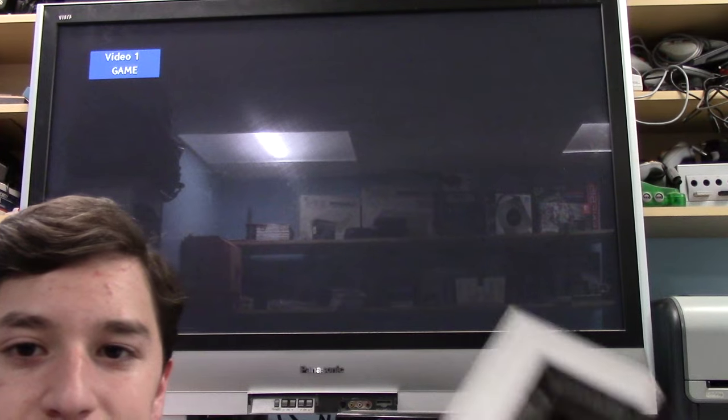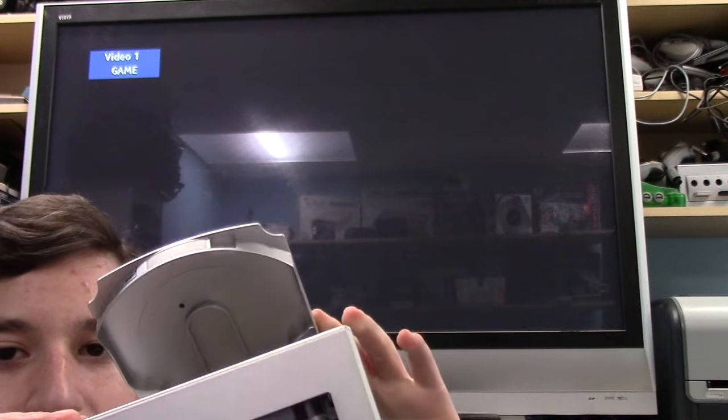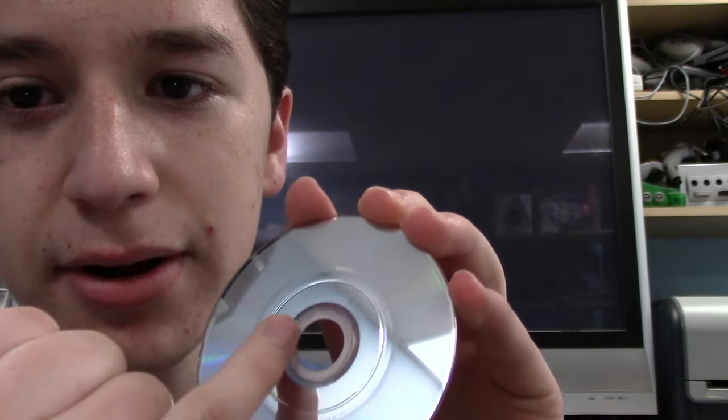Oh, and if you're curious — I took my GameCube lid off. What I've been doing is fooling it into thinking the lid was closed by using my finger. By doing that, I can see exactly where the laser is trying to read the disc, so I can see where the problem is. While that's not insanely helpful because you can't specifically polish just one spot — or else you'll create problems — it's still nice to know. If it's on the outside, you know it's because of warpage; if it's on the inside, it's probably a scratch, because usually there's not much warpage on the inside.